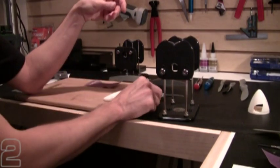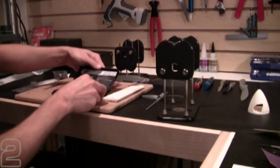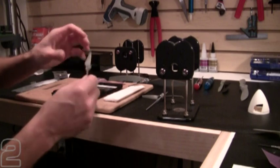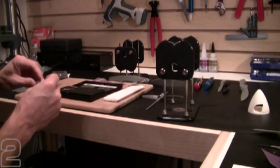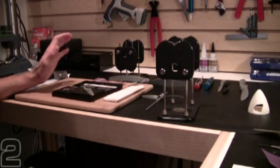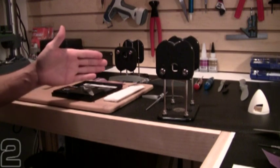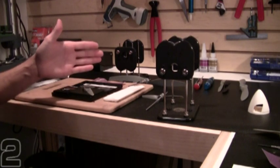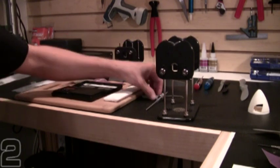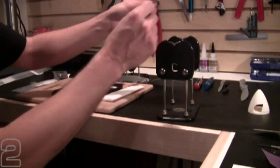When we look at these smaller props and pull out our scale — this is another 5x5 that's actually been balanced and used — the weight of a 5x5 prop is 3.4 grams. There isn't a whole lot of weight there. If you divide that in half and look at the balance, the off-balance blade would need to be heavy enough to swing to the low point on the arbor. There isn't a whole lot of weight there to force this entire metal shaft to center out.